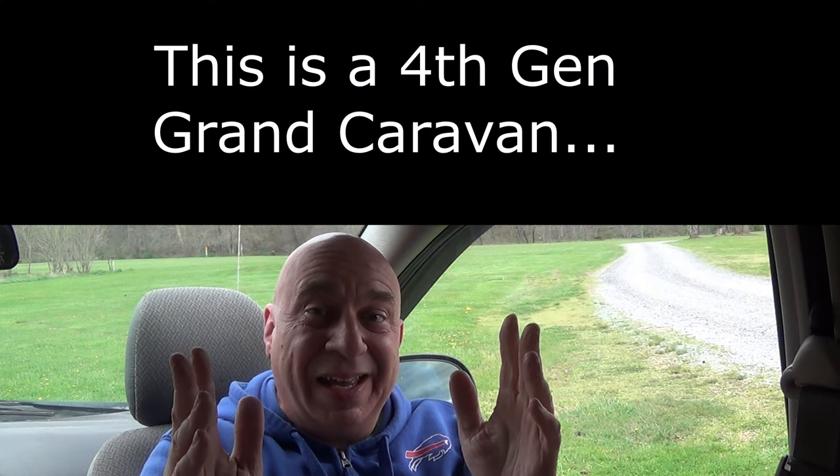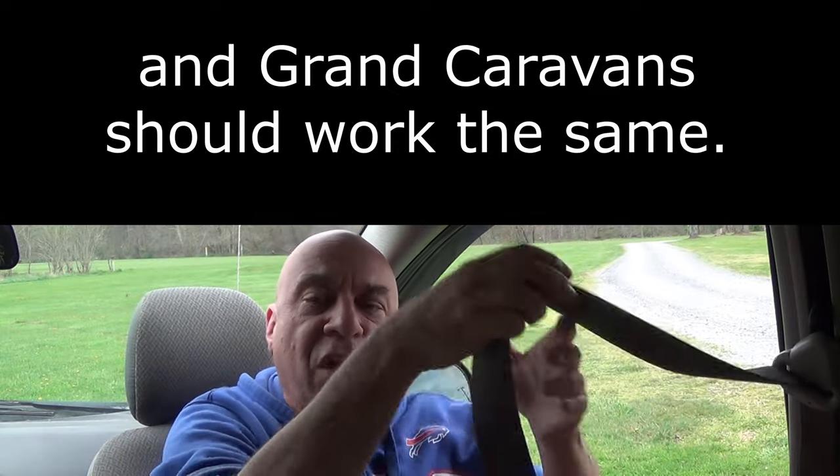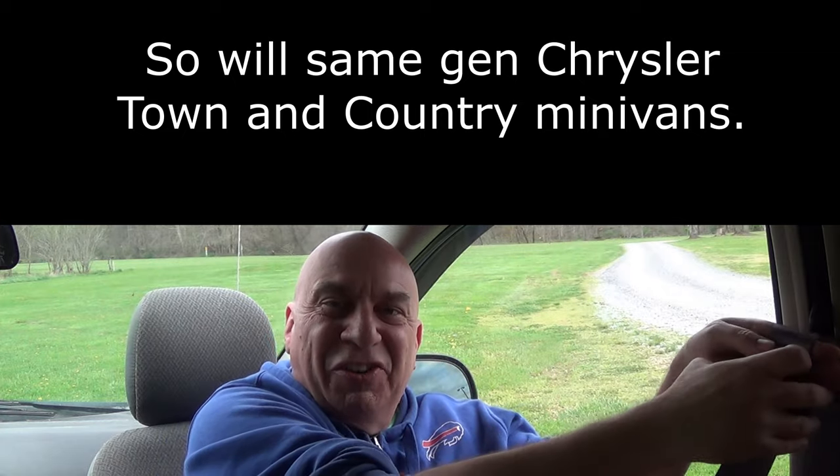So if the question is would I do this again, the answer is absolutely. I will either completely remove the seat or turn the seat around in any minivan I ever have in the future. And if the time came to sell your van, all you'd have to do is unbolt those four bolts, turn the seat around, and bolt it back down - making it normal again. Keep in mind it's going to be a slightly different process depending on the model because sometimes seat belts actually go through the seat, so you'll need to take it apart enough to retract the belt. But it's doable - just a different process depending on brand, model, series, and year.